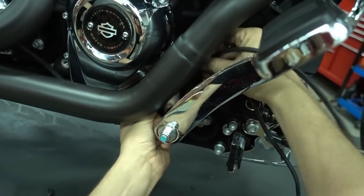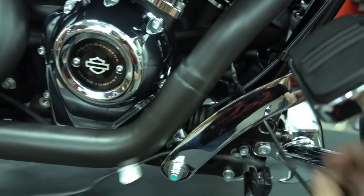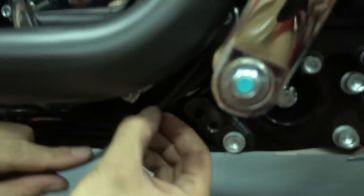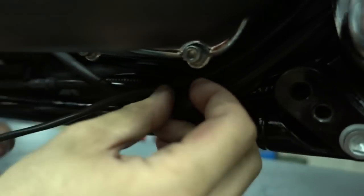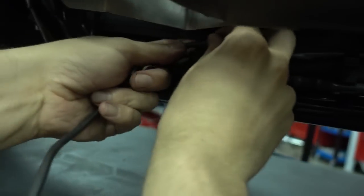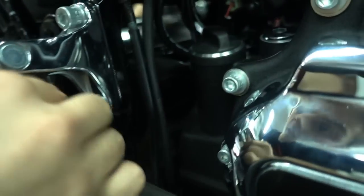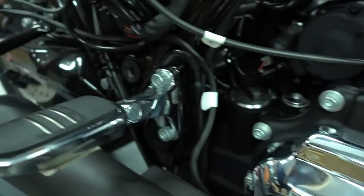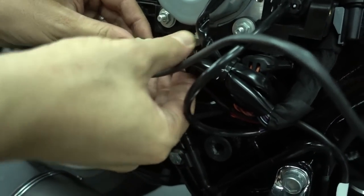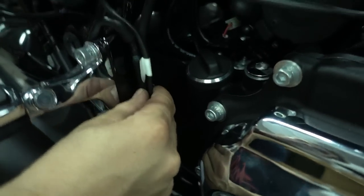So I put the cable through here, behind the brake, pull it through, and now I put it back into these clips which are here. So first clip, second clip, third clip. Now I route the cable back up here. And here I can just plug it in. After we routed both, I will use some zip ties and tie it here together like it was before.